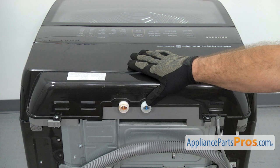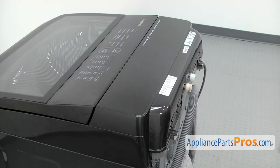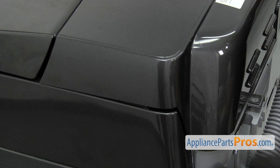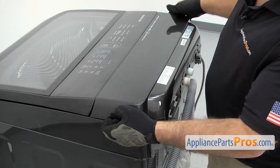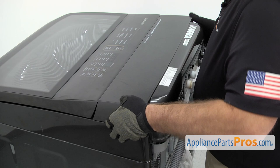In order to change the part, we have to take this cover off. We're going to use a Phillips screwdriver to take out the two screws that hold it in. Now that you have the screws out, we're going to lift up on the panel a little bit in the back. Then in the middle on each side, there's a little locking tab that we're going to press in with the putty knife. You want to be careful — these tabs are pretty fragile. Somebody's already been in here and broke ours off, but we'll show you where they're going to be. You just want to press right here and lift up, then do the one on the other side. There's also a little tab right here that's busted off on ours — you want to lift it out of the hole so the hook comes out. Once you have both sides done, there are a couple of tabs across the inside that you don't have access to, so you just have to lift up on it and flex it so it comes off. Once you have it free, set it aside.